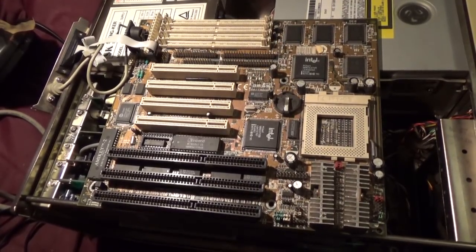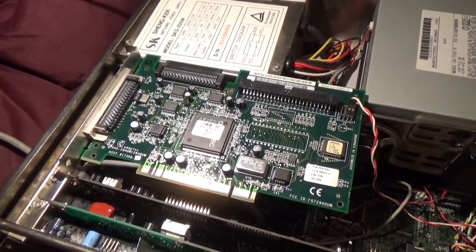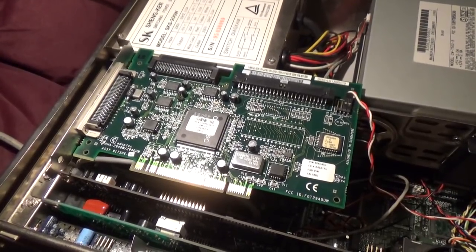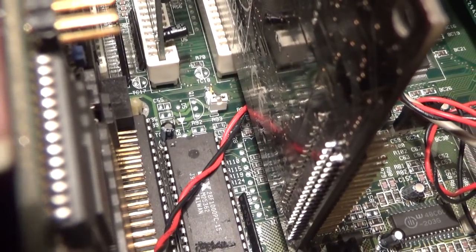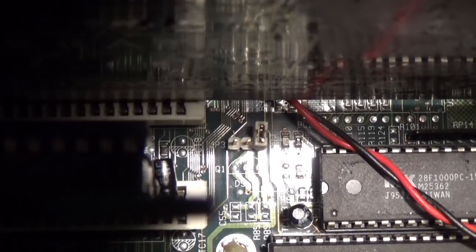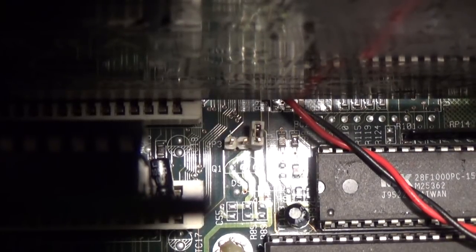This board's absolutely brilliant. There is a last note to make about the motherboard, and it's a quirk I have noticed, and a fatal one. If you get one of these, pull this BIOS flash voltage jumper off. For some reason, the SCSI BIOS initialization activates the write pin for the BIOS EEPROM and copies itself into the first half of the ROM, leaving you with a non-starting motherboard.